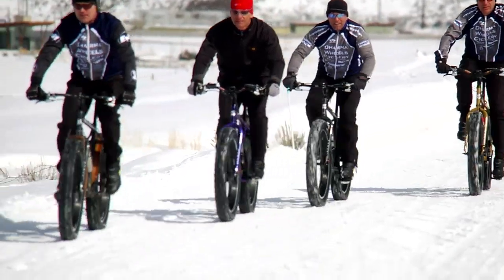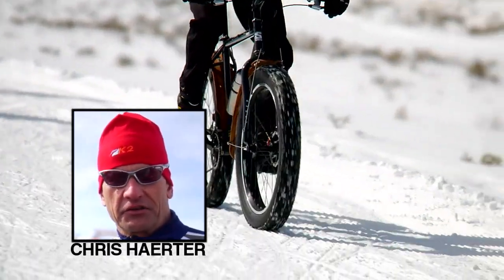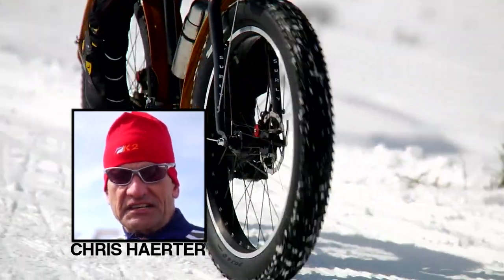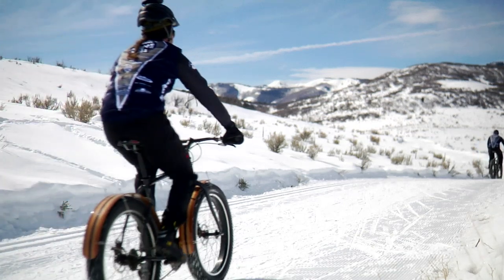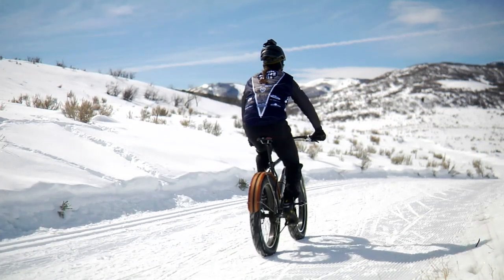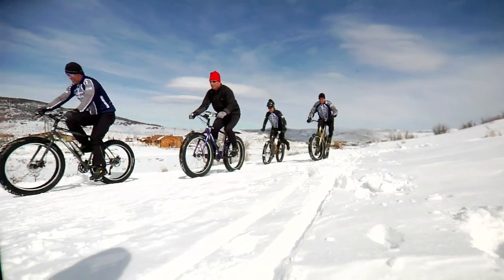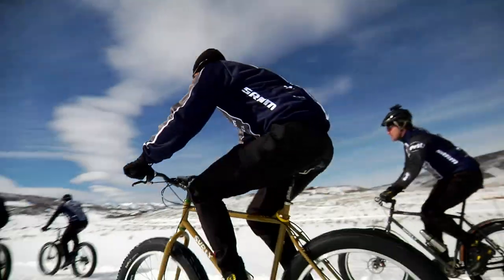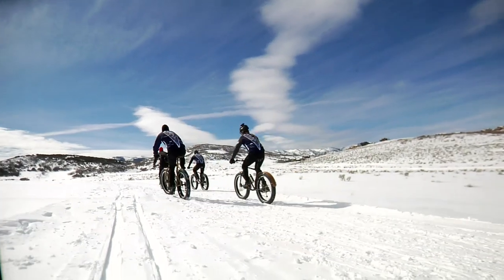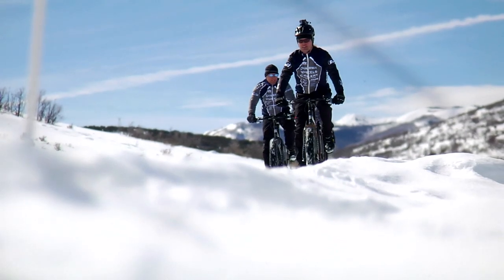These things run at incredibly low pressures. If you run about 16 PSI, that's effectively rigid. You can get down to about 6 PSI, where the tire will actually spread out and flatten a little bit, and you can get more tire surface on the ground than you'd have with your feet. What I've found is that you can ride just about anywhere you can walk. If you punch all the way through in a post hole with your feet you probably can't walk, but if you're punching through 3, 4, or 5 inches, you can probably pedal the bike on there, which is a lot of fun.